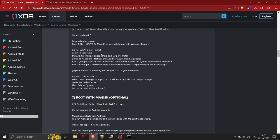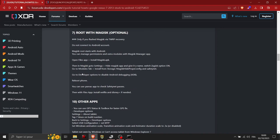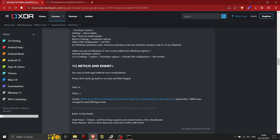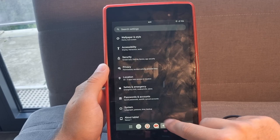Select the ZIP, click Install, and see if it works. If it does, you can optionally try GApps afterward or stay without them. Magisk is optional — you don't need it. Once the installation is done, when prompted, tap 'Wipe Cache/Dalvik' and swipe to wipe. Then disconnect the tablet from your PC, reboot, and let the tablet start up for a few minutes. You should now have Android 13 running on your tablet.